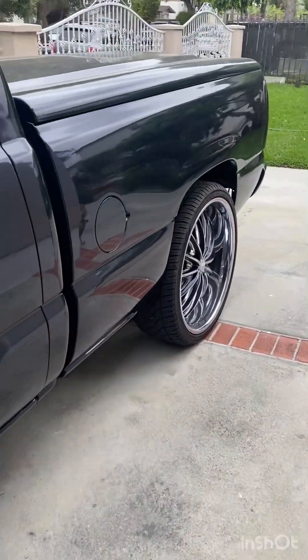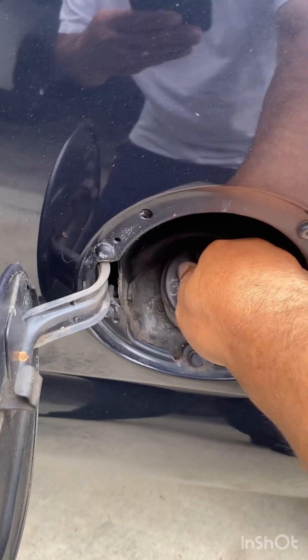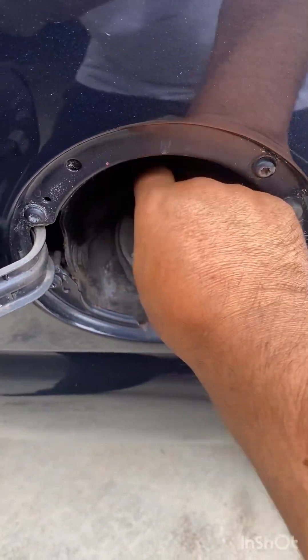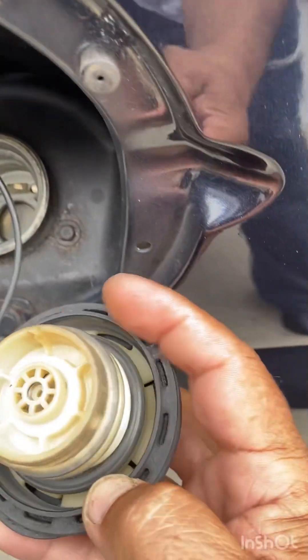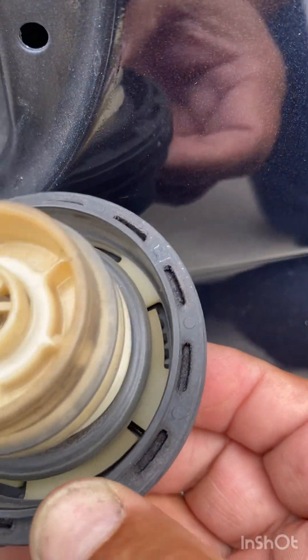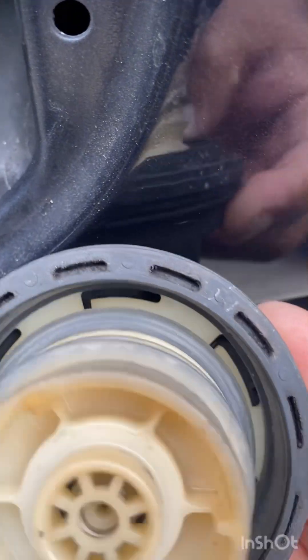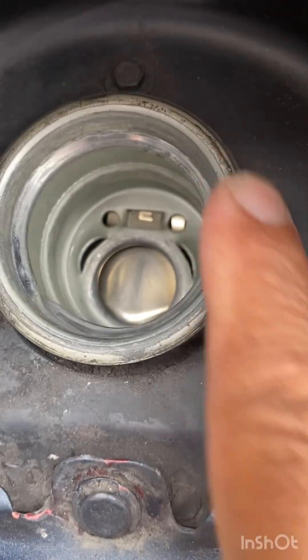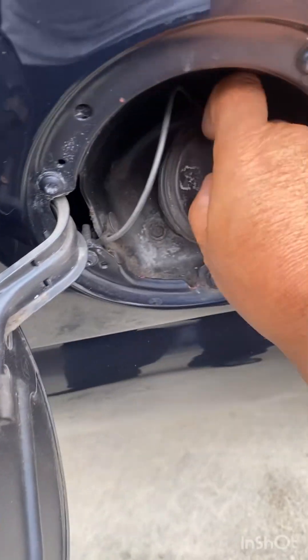To correct this issue you want to check several things. We're gonna go with the easiest things first - that will be your gas cap. If your gas cap is loose or not put on right, it may be damaged from the gasket here. I'm checking the seal to make sure it is not cracked, broken, or damaged - which it's not. Check for rust around here - no rust. It's not damaged, not cracked, not broken, gas cap is fine.